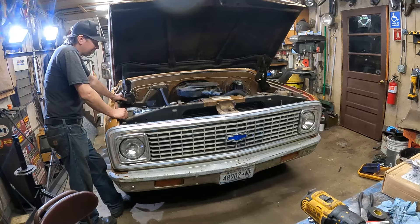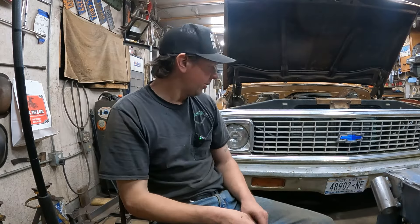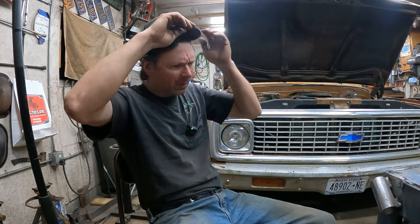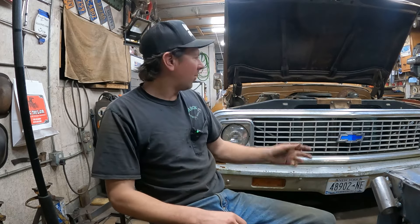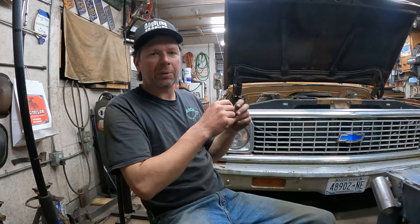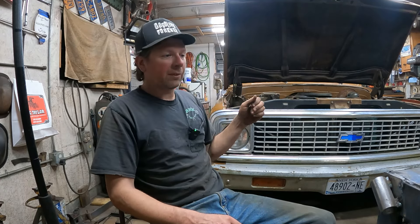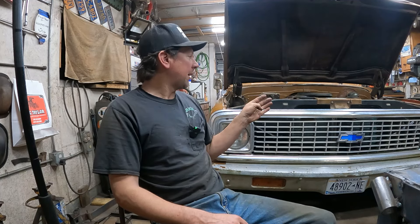When I was under the engine, I noticed somebody's worked on this a little bit. The transmission's painted black — it's a cast iron three-speed. It needs a seal. The oil pan is a little scaly with some rust pitting. The engine's leaking some oil. I found a burned-off connector that I cut off and taped up. It's got the HEI distributor and somebody ran a new power wire to that. I think the old wires used to go to the points, so I taped them up.